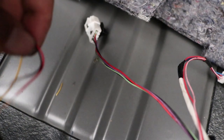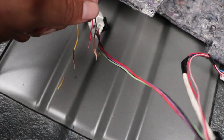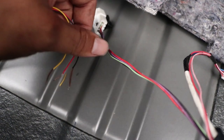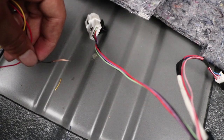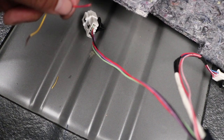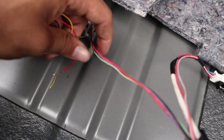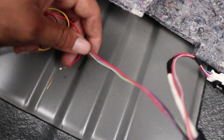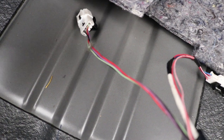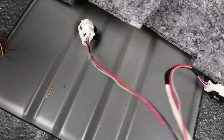Just like we stripped back the wires for the lights, we're going to strip back some of the conduit off of this harness. The way you're going to want to connect these is: black with black, red with red, yellow with the olive green color, and nothing with the purple. Then I'm going to strip these back, solder them together, put some heat shrink on them, and we're good to go.